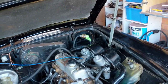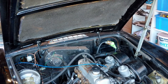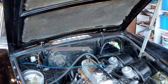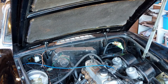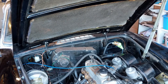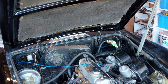I'm going to go with the clutch. In order to do the clutch, what I've been told is it is stuck to the flywheel. Because I can't actually get the car on the road, what I need to do is jack up the back, run the car till it's warm, and then put it in gear and slam on the brakes at the same time, which hopefully will help it pop into gear. Do that a few times and eventually the clutch should free itself loose.